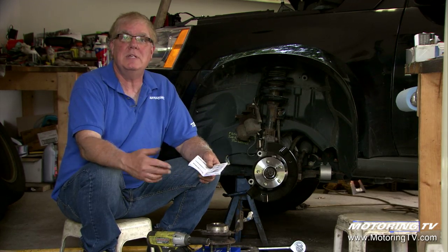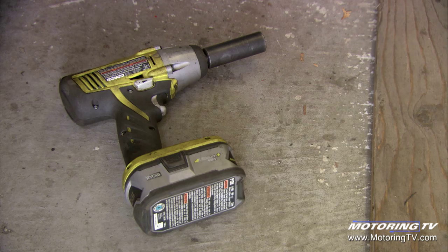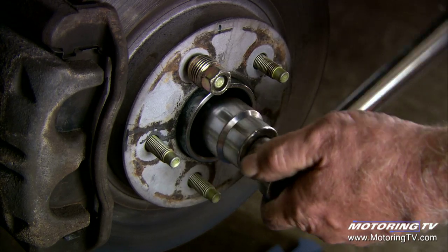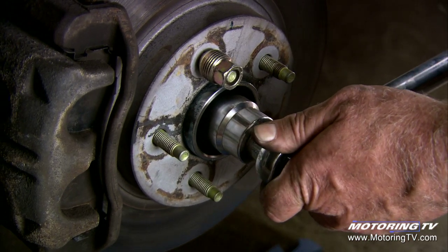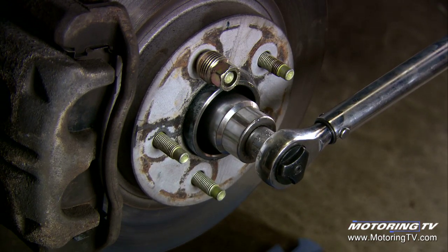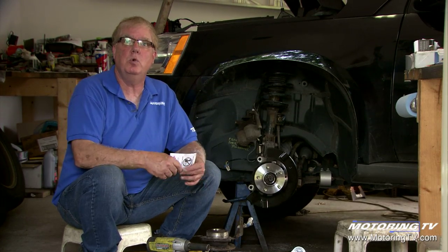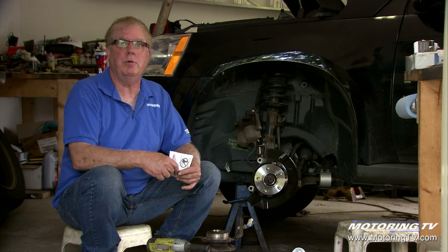The way that happens is mechanics using a pneumatic or air impact gun that's too big or too strong for the job, and not doing the final torque with a torque wrench. Those guns just have too much power for many of these fasteners — helpful when getting things apart when rusty and seized, but it works against you when introducing a new part to the vehicle because you'll do damage to it.